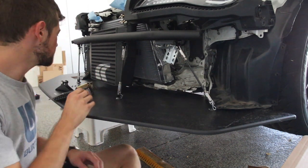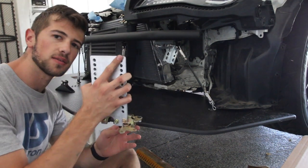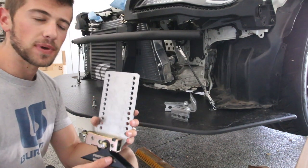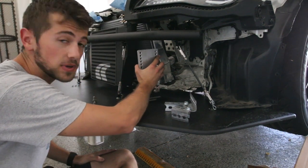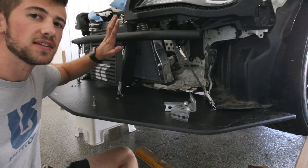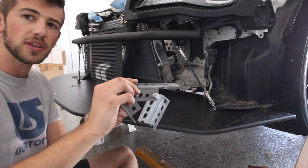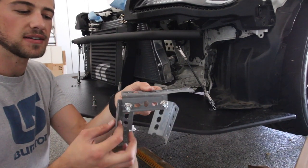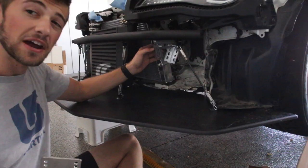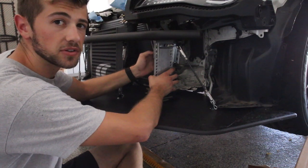Now that the splitter rods are installed it's time to install the splitter mount. To assemble it, put the three 10mm screws inside to connect the mount to the plate, then install the base into the plate. Unfortunately the back plate of the splitter mount isn't high enough to reach the JDL bumper bar — if you have the stock bumper bar it may reach without modification. For my needs I built a custom contraption that attaches to the two M8 by 1.25 holes on the JDL bar and then attaches to the splitter mount. Once installed, the splitter mount lines up perfectly and I use bolts to attach it to the platform I built.